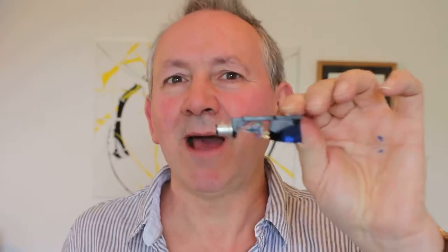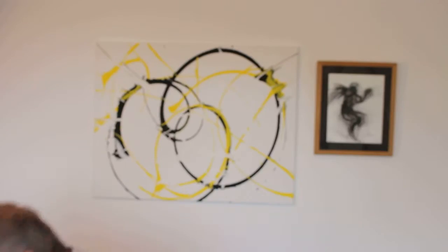Don't over tighten it. You can definitely strip the thread. Any grown man can strip the thread. But if it's loose, you don't want loose. Firm. Also, when this goes into the arm, tighten that up. Keep that firm too. Rigidity is key to making turntables sound good. You don't want your turntable to be wobbly. Make sure it's not wobbling on its surface.